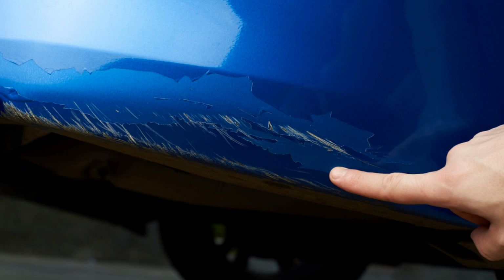1. Determine what type of plastic your bumper is made of. Plastic bumpers are generally made from one of the following materials: polyphenylene oxide (PPO), thermoplastic elastomer (TPE), polypropylene (PP), thermoplastic polyurethane elastomer (TPUR), or rigid polyurethane plastic (PUR). Bear in mind that the first 3 may smear when sanded, while the last 2 may powder. Be guided accordingly when grinding or sanding.